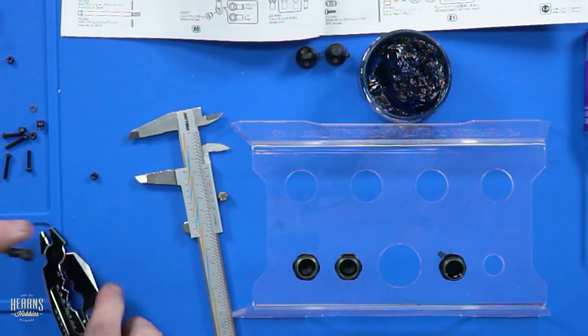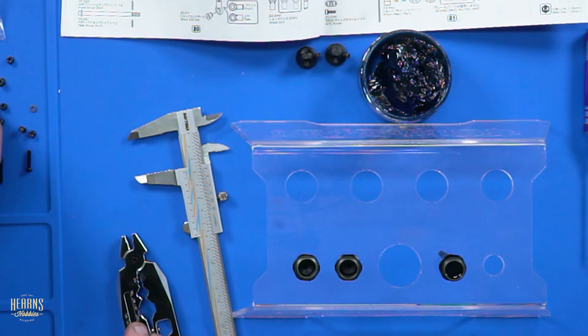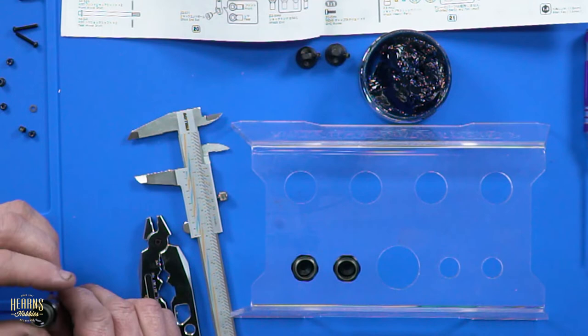They're emulsion. What is the definition of emulsion? Aeration. The aeration, so you've got air particles or small air droplets in the oil. You cannot stop it happening. That's right. It's basically contaminated oil. Yes. It's actually an inferior dampening system. What would you like to see happen? If you could seal the cartridge, have a piggyback, a nitrogen piggyback, and have valves, it would be awesome.